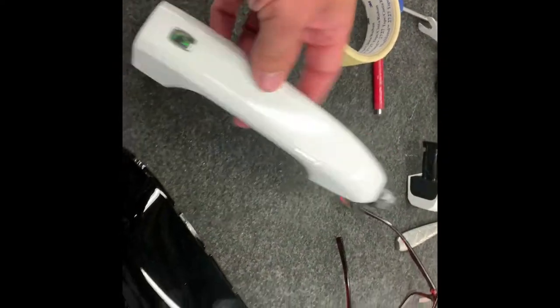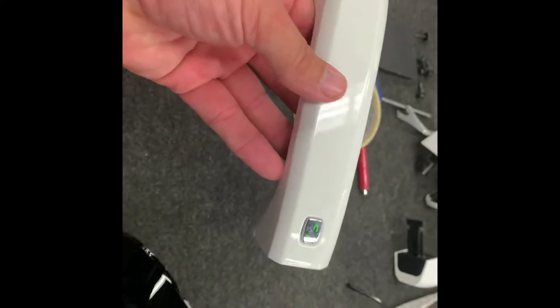Here's the mirror - the mirror base. Heat sink for the LED lights. So you have to take the mirror base off to get access to the glass and snap the glass from the base so we can get access to the back tabs - the fingers that latch onto these tabs right here. Pretty tedious stuff. Had to get rid of the handles, maintain them, and leave the chrome button. A lot of tedious action going down with these de-trims. But if you're going to do it, do it right. What's the motto, Richie? If you want it nice, do it twice.